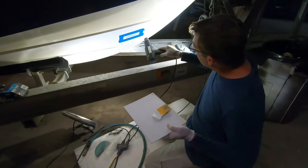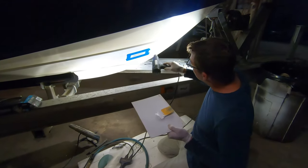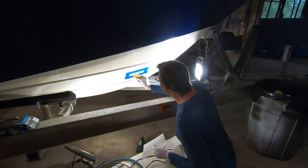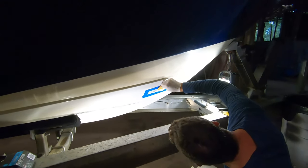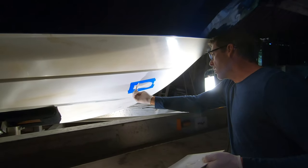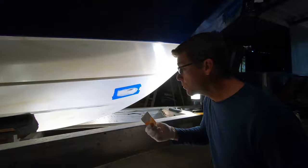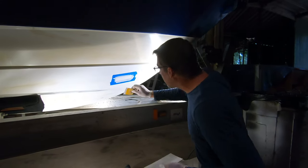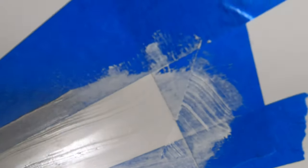We've already taped, bordered, and sanded. I'm going to warm it up just a little bit with the heat gun — we've got some rain moving through with high humidity today, so I just want to be sure this is warm and dry before we apply it. We're going to carefully work that into the damaged area, push it in, make sure it's making good contact, working it back and forth two or three times. Don't expect it to be perfect on the first pass — there may be some little bubbles and it may be a little low on the fill, but that is quite all right.